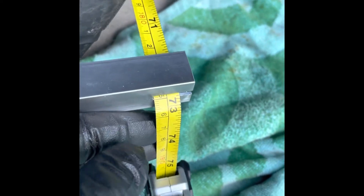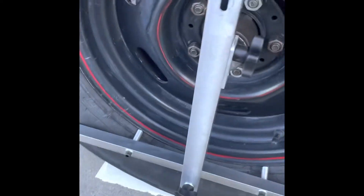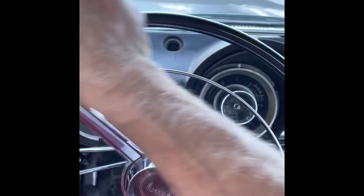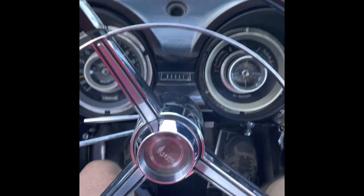1/8 to 1/16 to 1/8 on that. If you pull them tight you can check toe-in. Pretty darn good — stops straight. I just gotta straighten out the wheel, and that's easy compared to everything else. You're welcome.